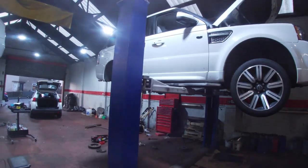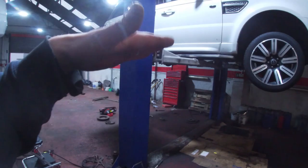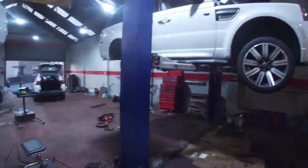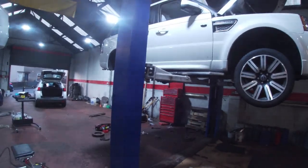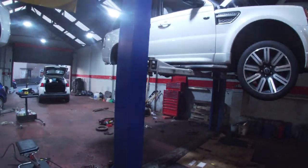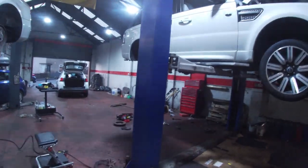when I started it up, but a couple of times I started the cab up and I had a slight vibration, like just one of the cylinders just wasn't fired up, hasn't lit up the candle on that cylinder, whatever one it is, and there's no codes other than that turbo underboost. So could be a glow plug going, could be an injector, could be anything really, to be honest with you. But it's literally there for a second, it's gone, eh?